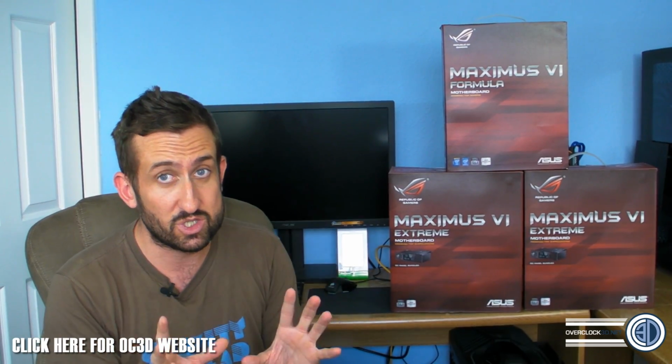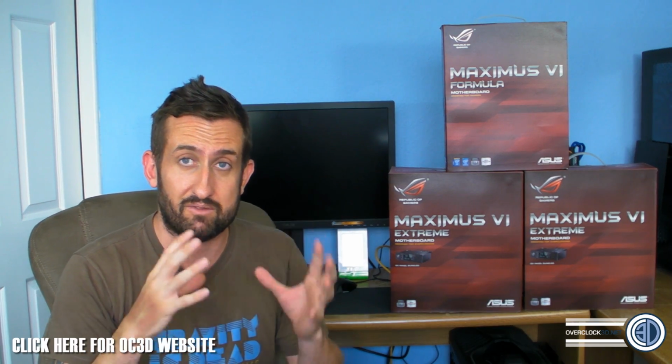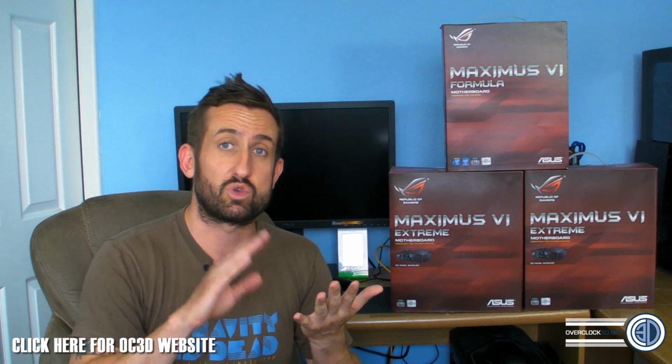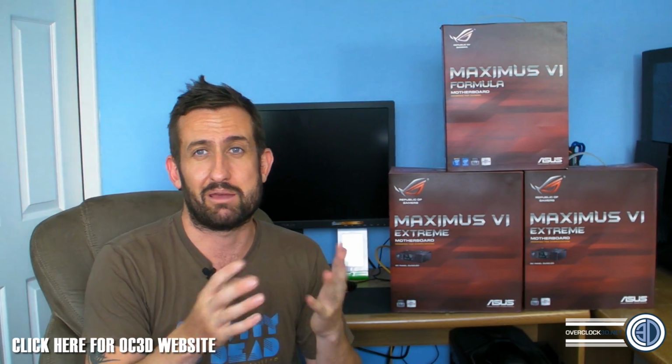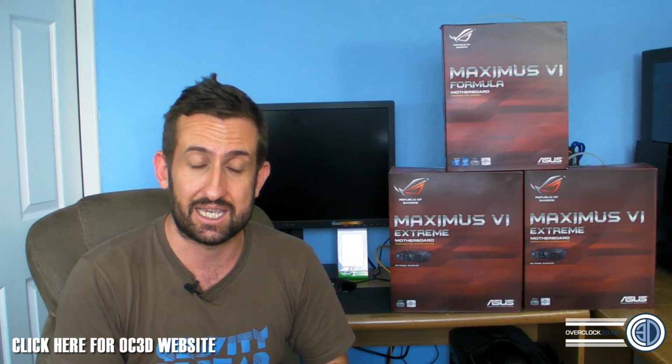And that's because the products, sorry, the motherboards are much more able to get what you can out of the CPUs. Back in the days of X58 and stuff, if you bought a cheap motherboard, you'd get an average overclock. You bought the expensive motherboard to make sure you got a better overclock and better memory speeds and stuff like that, because the more expensive motherboards did have more power phases, and the CPUs did need it.